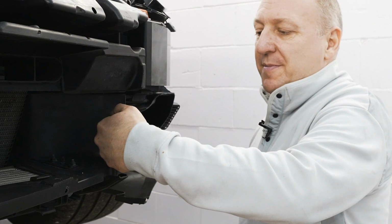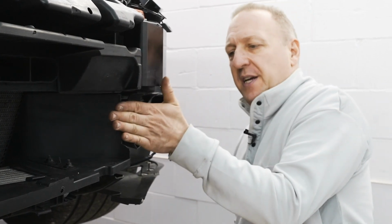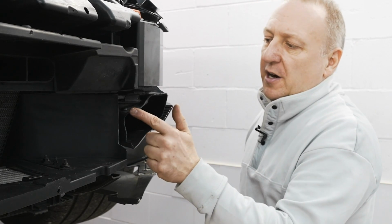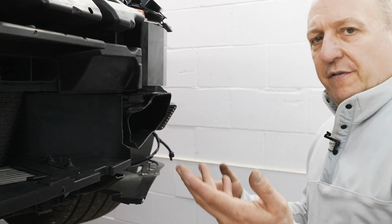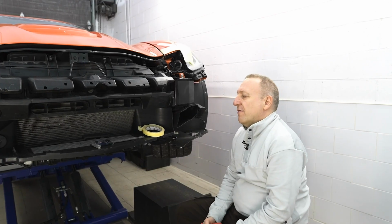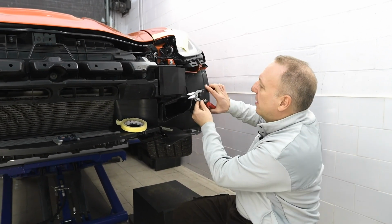Next is the Z51 ductwork. I'm using this as my baseline. So I've already pre-trimmed this one. I did a horizontal trim and I'm keeping it tangent to that. So I'm removing about 1 inch off the ductwork itself, all the way up around. Once this is done, I can use some sandpaper just to clean up all the surfaces, try to fit the bumper assembly and make sure I got the proper clearance. I'll now trim the driver's side ductwork and I'm using my snips.